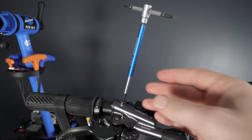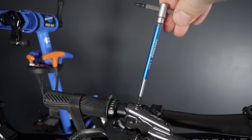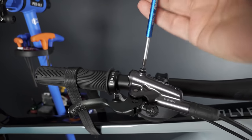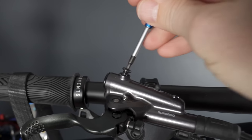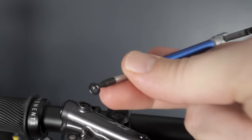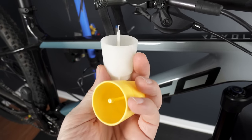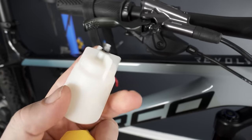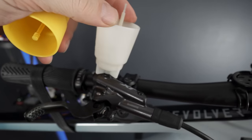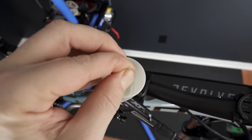We're about to open the brake system, so put your gloves on if you want to protect your skin. Using a 2.5mm Allen key — lefty-loosey, righty-tighty — carefully remove the bleed port screw. Be very careful: there's an o-ring seal that often doesn't come out with the screw, so reach back in to retrieve it. Definitely save the o-ring — best is to put it back on the bolt. That's where your oil funnel is going to attach. Put the funnel on and tighten it gently. The oil funnel is plugged with the oil stopper — just leave it plugged for now.